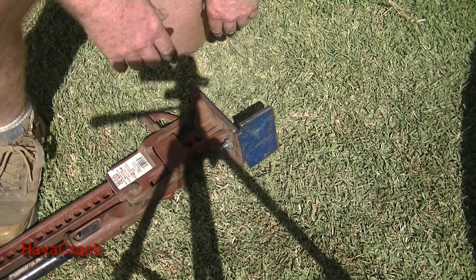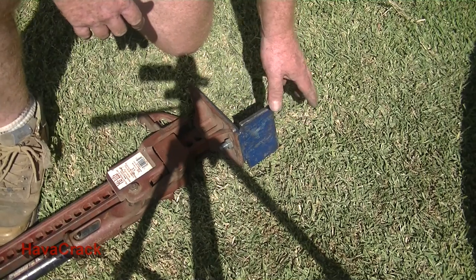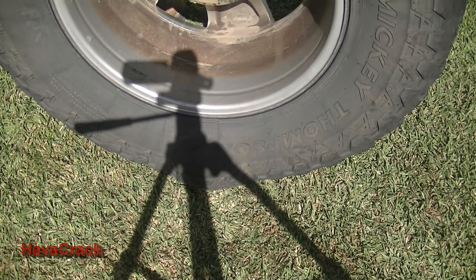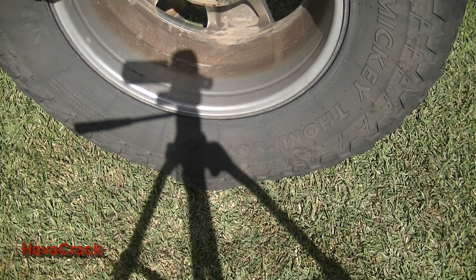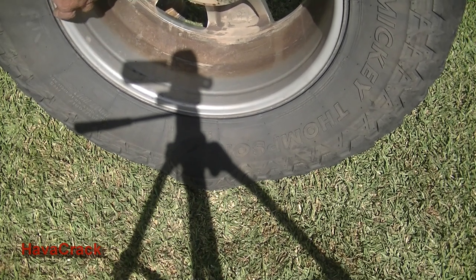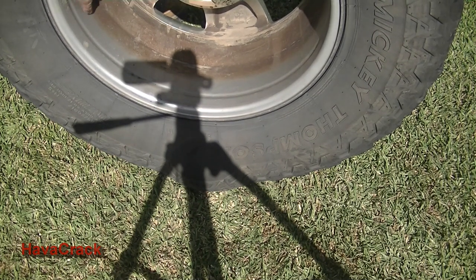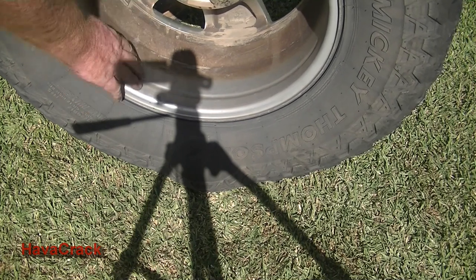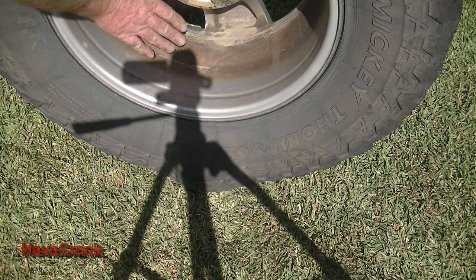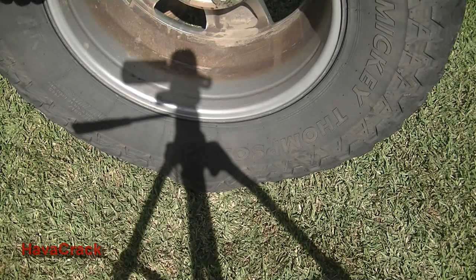So we'll turn the tyre around under the front of the bumper. We'll take the valve out, and then we'll set this up to break the first bead. Now, when you're taking your tyre off, you want to get the tyre eventually into the deepest part of the well. On these Nissan wheels, the deepest part of the well is on the outer side of the rim, out this side, and not this side, but we're going to break both sides anyway. On a steel rim, you've generally got a greater well, which is even on both sides. That's why they're easier to remove than these ones.